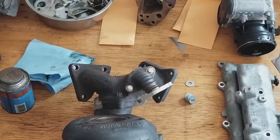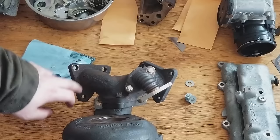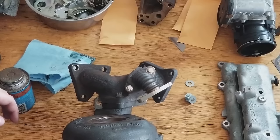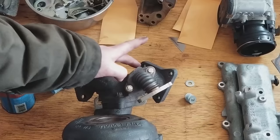to get them out. So as far as this turbocharger goes, you have three bolts on either side for each exhaust manifold coming out of the V6. Each one of these is an E12 Torx. They take quite a bit of strength to get out of there, so I recommend using an impact wrench or a breaker bar. And you have three E12s on the other side as well.